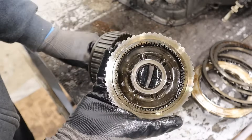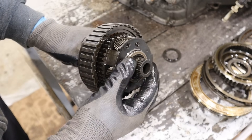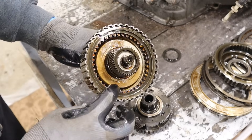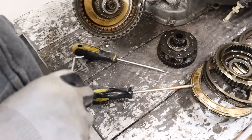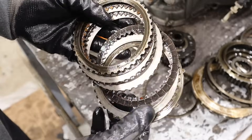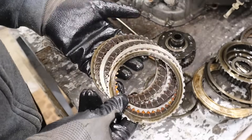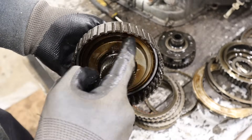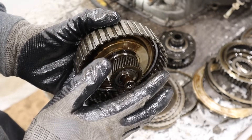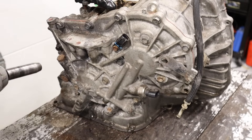Pulling this thing apart, you can see the ring gear, which is going to spline to that clutch. And here we have the planet carrier — this is going to spline to the first variator on the input side. It's got teeth on it which spline to the clutch on the inside. Let's take a look at that forward clutch. Honestly, the forward clutch is not looking in the best shape either — the friction materials are starting to wear down pretty aggressively. If you left both of them disengaged, you'd have neutral. In order to activate this clutch, we have the piston on the inside here. Fluid is sent through these holes in the center of the shaft to fill it up, and that presses against that clutch to lock it. Now that we've removed the front half of the transmission, let's remove the variators, which come off the rear here.